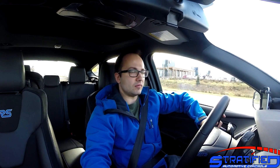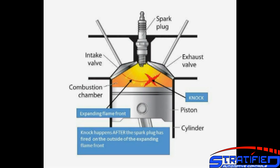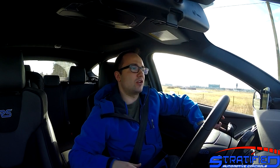That creates a really hot gaseous mixture that pushes the piston down — that's how we achieve power. Detonation is when this expanding fireball traveling from the spark plug tip starts a separate fireball on its edge — a separate combustion process. Those two start to compete for space inside the combustion chamber, creating different pressure waves that hit each other and bang together, causing that pinging sound. Our knock sensors pick up that pinging sound and reduce timing as a result.